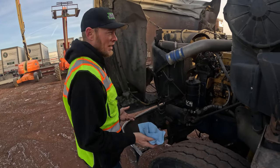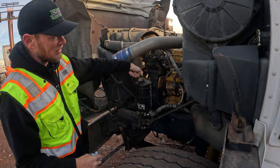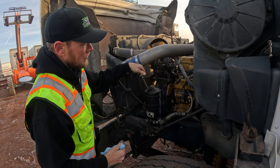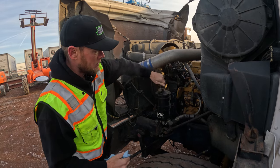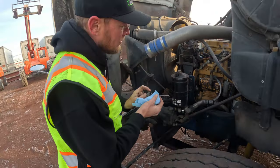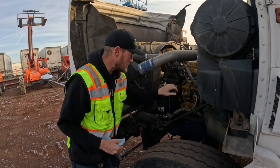You can start on one side — over here it's really just the power steering reservoir. You're going to go ahead and check the level of the fluid by unscrewing the cap and pulling it. There will be an add line and a full line. We're within range. While you're doing that, you're also going to be looking for any kind of leaks, whether from the hoses.